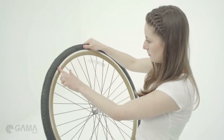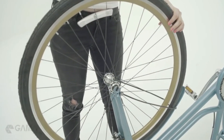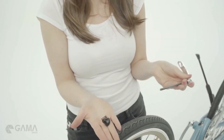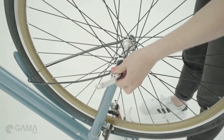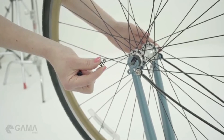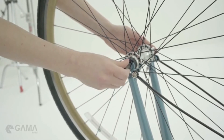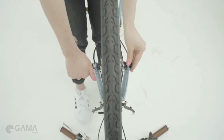The other wheel is a bit different. First, check the direction before placing it on the fork. Remove the plastic nut as well as the spring from the quick release. Then insert the quick release into the side that is opposite of the chain. When it's done, place the spring and screw in the plastic nut. The final step is to make sure that the wheel is centered and secure the quick release.